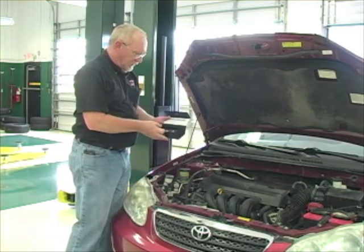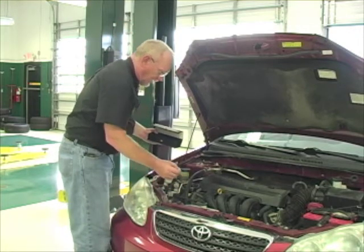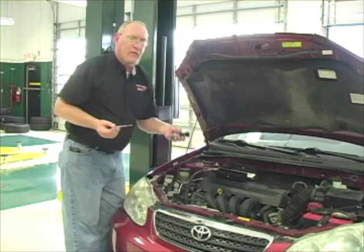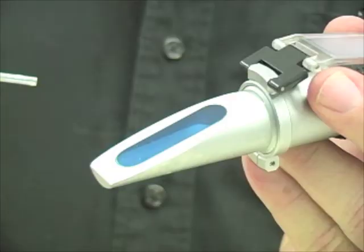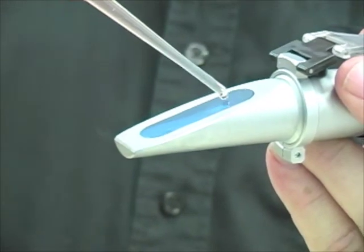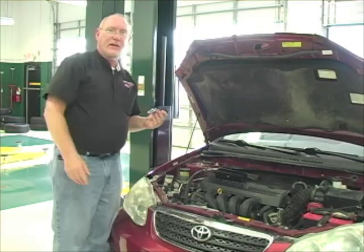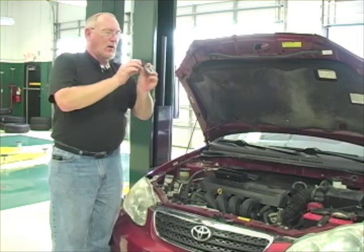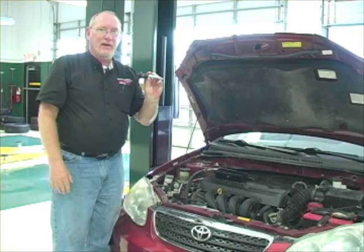The way this tool is used is very simple. We have a small eyedropper — we're going to take a sample of the coolant and draw that into the eyedropper. Then on the refractometer, we're going to flip open the lens and place a couple of drops right on the lens and then close the shield — kind of like making a slide when you were in seventh grade science class. Now we hold it up to the light while looking through the reticle, and inside you'll see a blue section on the upper side and a white section on the lower side. Right where those two meet is the concentration of coolant in the system. In this case, I'm only getting about 44%. That's still within the acceptable range, but since we're going to service this system, we'll get that corrected at the same time.